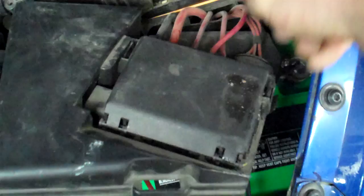Sometimes fans won't come on if there's a short. You've got a bunch of fuses that run under this cover, and they can corrode — once corroded, you won't get power. Also, where the wiring goes underneath here and under the battery, that can get destroyed and cause your fans to not work. But if you run power directly to the fan using the brown wire as your ground and running power to the others and it still won't come on, then you know it's a bad fan motor.